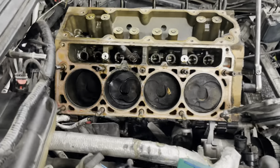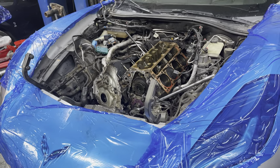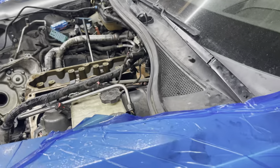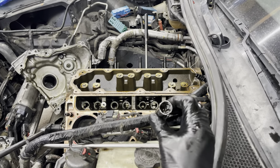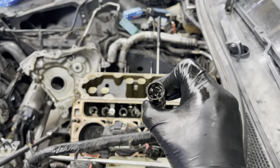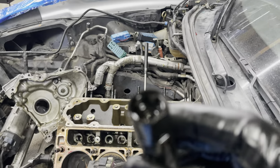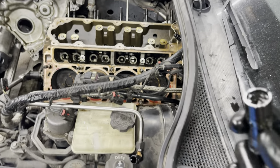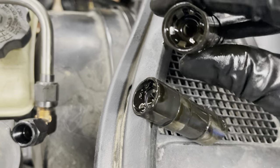We got the heads off. I do have a lifter stuck in the block. As you can see, it's stuck in there. I'm just going to call it a night for tonight. I got both cylinder heads off and actually did find the problem lifter. One of them — that other one stuck too — but this one was in cylinder 5. You can see it's stuck down, and this was the misfire. If you compare it to one in good condition, you can see it's way up, and then the one that's collapsed is way down. There was the problem child right there.